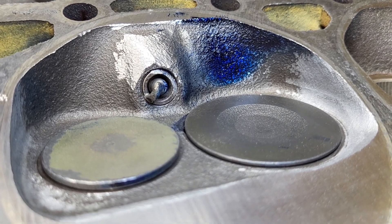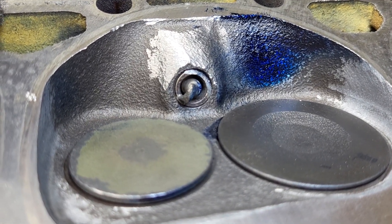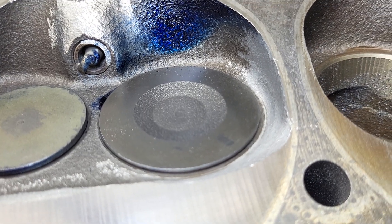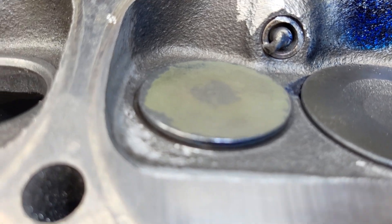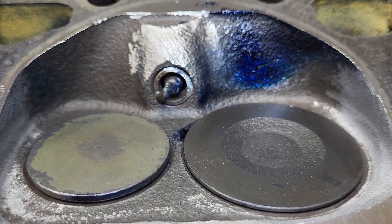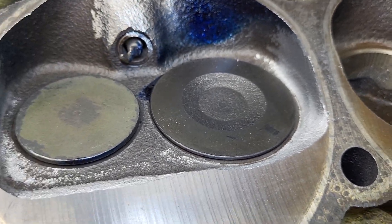We're going on the throttle body injection heads with 194 1.5 valves. The only thing I did is some quick and easy chamber de-shrouding. I brought it out to about the gasket line of a 350 gasket — it's a little on the sloppy side for me, but it was done at a high rate of speed because it was a very busy day.